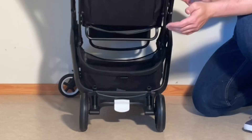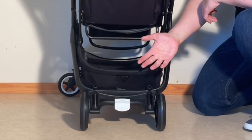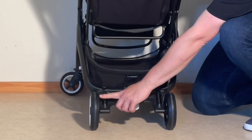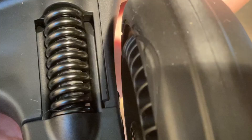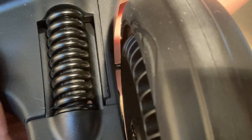Moving down to the rear frame, the Butterfly's suspension is pretty minimal but sufficient for a model meant to be used over smooth terrain. The brake system is simple and solid, rotation-based, and uses brake pins that extend to lock within teeth on the inside facing of the wheels. The thickness of the pins themselves is such that they may possibly bend a bit down the road, but note that this is easy to fix if it does happen, and that the whole system is disassemblable.